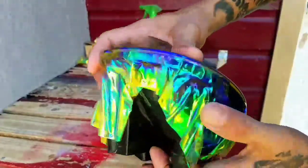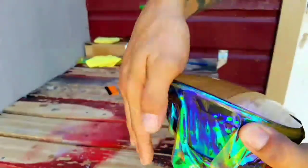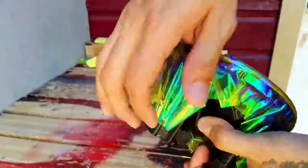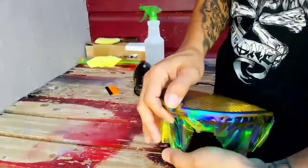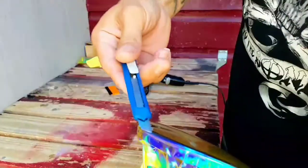After you stretch out all the vinyl to the sides, heat up the corners and pull it down. Make sure you get all the edges — nice and smooth, make sure it sticks. Be patient with this. It's going to take a couple of turns around the whole edge, heating it up and pulling it down. It helps if you have someone else helping you, but if you're doing it by yourself, just be patient. After you're done, get the utility knife and cut all around the edge.